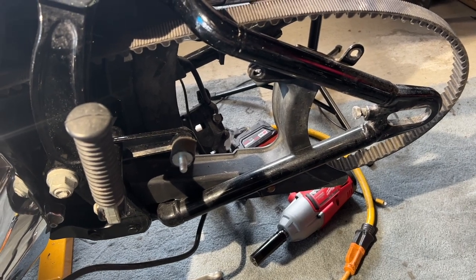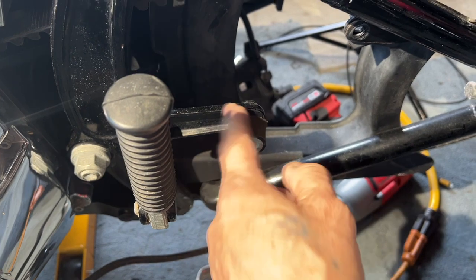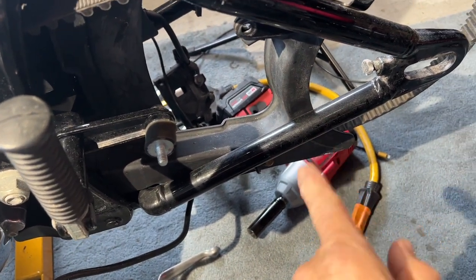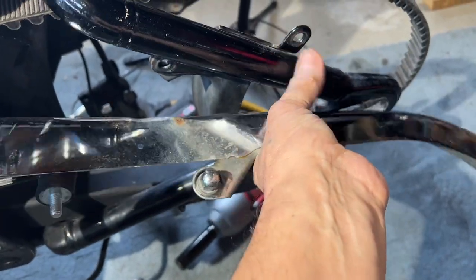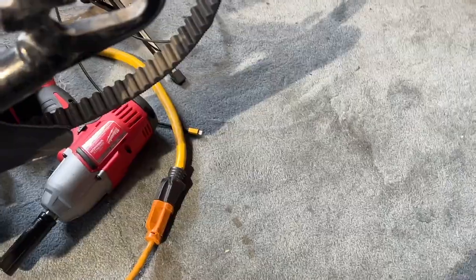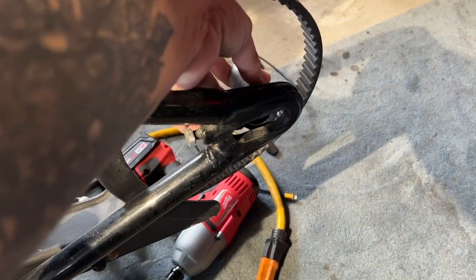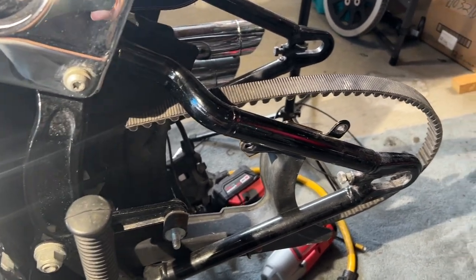Hey guys, I apologize for not moving the camera. But here's where the other bracket was, and this is the way they're supposed to look. You can see that the other one was completely torn, so I'm going to have to replace these saddle bag brackets after I get the new ones. The reason I couldn't remove the tire yesterday was because of the belt guard — I'll show you the belt guard mounts right there; it's got a bolt and a nut that mount right here. And the second reason is this is how big the spacer is in the back — that's why the wheel was pushed over quite a bit. I just wanted to show you guys that really quick.